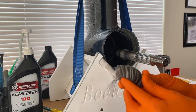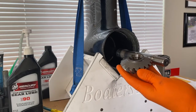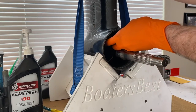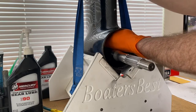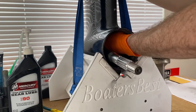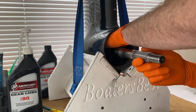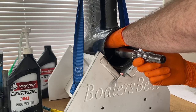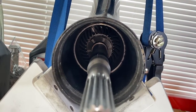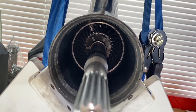With the pinion gear in hand, we are going to shift it inside the lower unit cavity upside down. We are going to carefully pull up on the drive shaft to allow this pinion gear to shift in place and align the internal splines - just be patient, this does not happen within seconds. To get better clearance, I shifted the propeller shaft to the left. As I shift that pinion gear down the cavity, I'm wiggling the propeller shaft, moving the clutch dog as well, to give more clearance to push that pinion gear into place. To ensure the pinion gear splines are aligned, ever so slightly rotate the drive shaft and the pinion gear and forward gear should rotate.